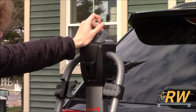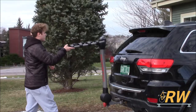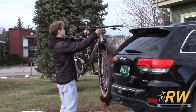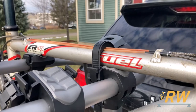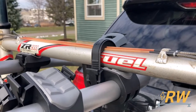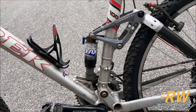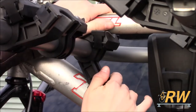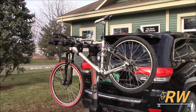When you're ready to load your bikes, pull the gray lever on the top of the bike rack to fold the arms to the loading position. Then load your bikes in the order of the heaviest first. With your bikes in place, install Yakima's zip strips around the top tube and the seat post to secure them to the rack. If the seat post has a shock or water bottle holder interfering with the zip strip, you can flip your bike around and install the anti-sway zip strip around the down tube to help keep the bike stable.